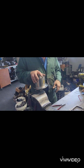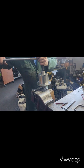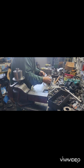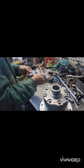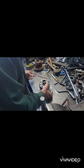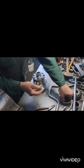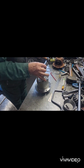So, now the bell washers in there, the preload washers should be, okay, it's turning. That's how it should be. It's back to how it was. We had 5 thou shim out of there. Yeah. Oh, it is there, you see. Yep. So all we've got to do, as I say, that's the secret, is to put just flat ones in. You know whether you're going too far or not enough. Within 5 thou, that is. Anyway, we can loosen this off. Because I'm not going to put these pins in here. Now, sort them off later.